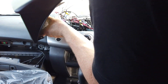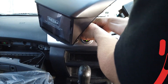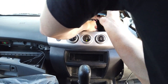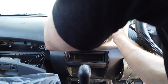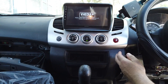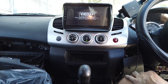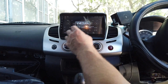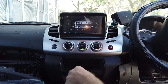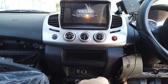Start from one side and work your way back so you don't forget anything — you probably will forget something. AM/FM needs a good push in. Float all the wires back — there's plenty of room on this model. Before you put it in, do that test we've done. Got no power — need to double check something. Sorted the power issue. Now check steering wheel controls are still working. Sound — awesome.